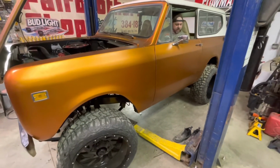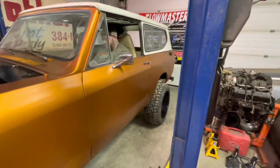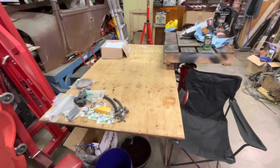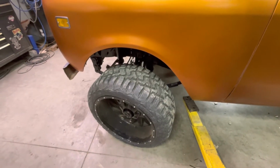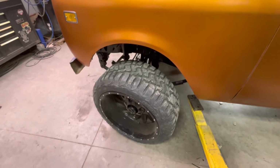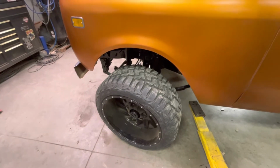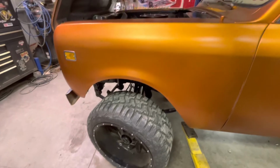And thank Part Source for our speedy delivery of the new brake shoes. Oh yes, the brake shoe dilemma. Where'd they go? They are gone. Anyway, the front shoes were too wide, right? Yes. 2 1/4. They needed 2-inch shoes. Went to put the wheel on. Wheel did not turn. The drum was binding on the shoes. So yes, thank you to Part Source for helping us out with that.